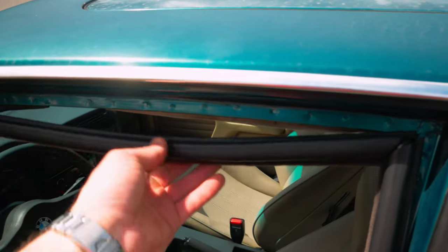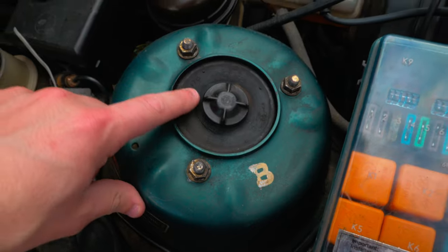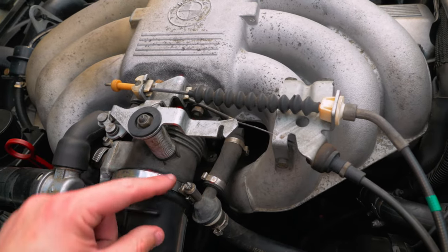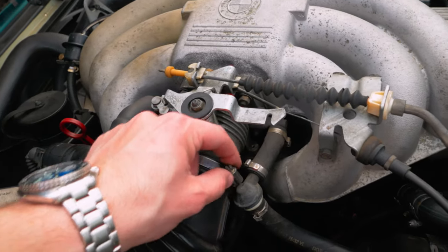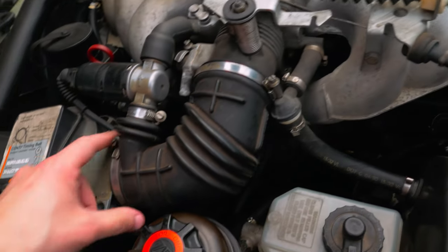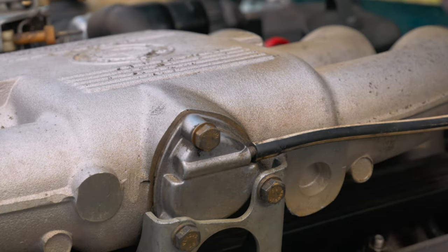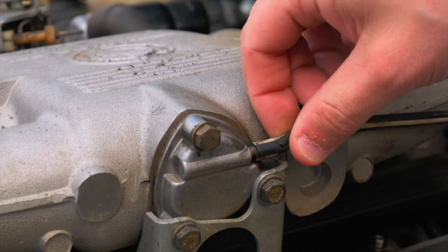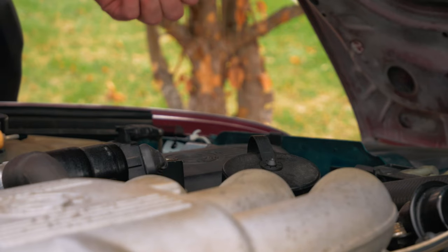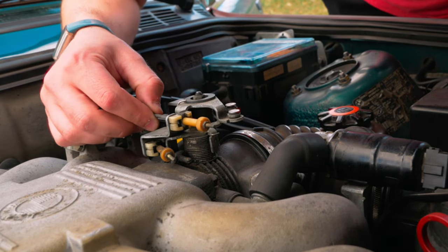The weatherproofing seems to have shrunk a bit with age. Along with that, the rubber bushings on the top of the struts seem to have a few cracks in them — nothing major though. The radiator hose also has a patch on it, but it's not leaking. The intake, however, is another story. Not a single part of the intake is actually attached — it's all just sitting there. I'm assuming someone had this off before I bought the car, and recently at that, and they didn't even put it back on correctly. On the other side, it looks like the valve cover gasket is also leaking. Not nearly as big a deal as this giant vacuum leak in one of the few vacuum lines this car has — an easy fix though. At least the oil looks brand new, which makes sense since the car came with paperwork proving that. Still good to double check. I also noticed there seems to be a good amount of play in the throttle cable — it looks adjustable, so I'll have to look into that.